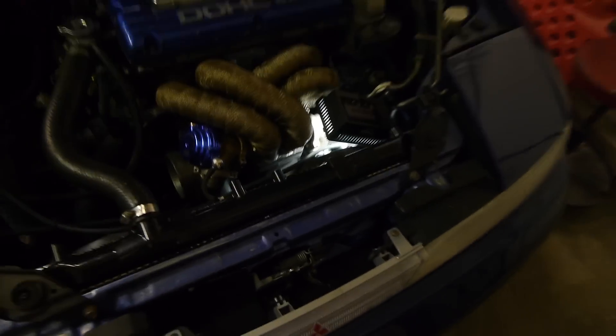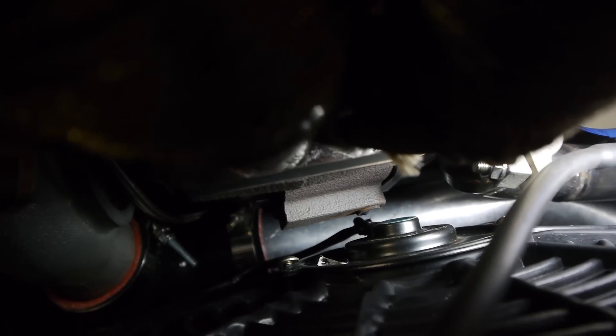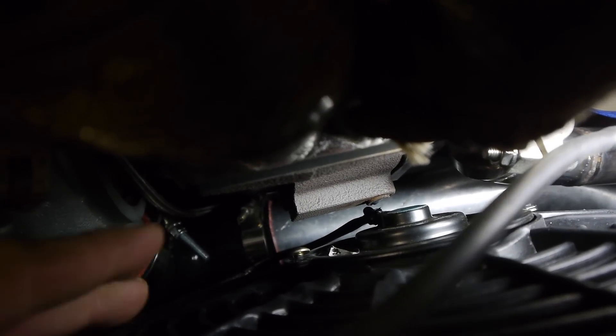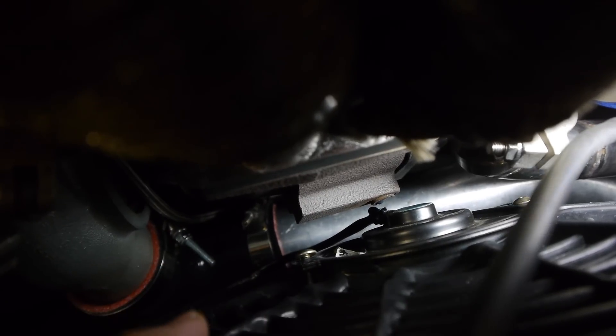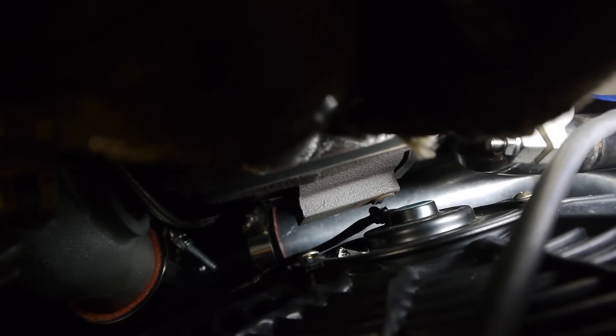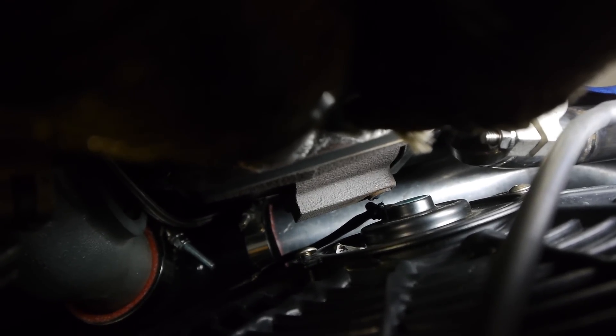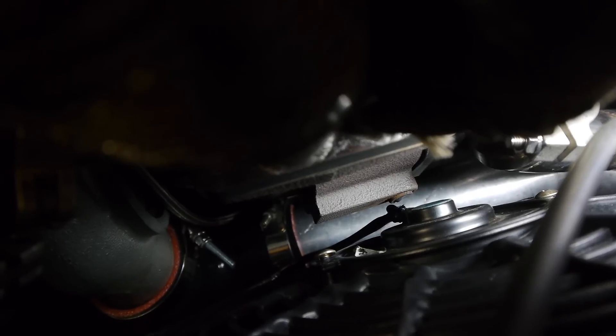Here's the clearance I'm talking about. Not only did it melt the wiring, but all this plastic has started to melt — it's all melted. You'll see it better once I get the fan out. Hopefully a turbo blanket will kill enough of that heat that it's not going to kill the next fan. So the radiator's coming out.